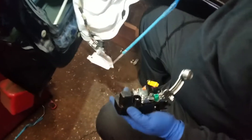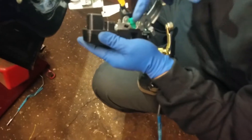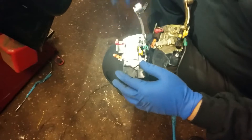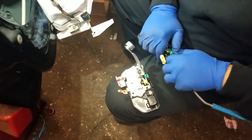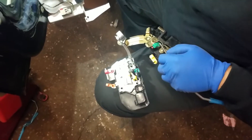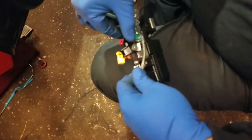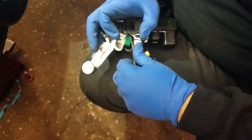We're going to start with the parts. As you can see, it has four little rods that are going to be connected to it and they are color-coded: green, yellow, orange, red. You have to make sure you remember which one goes where. In this case, the green one is going to be for the door handle — the one inside the car. Make sure you put that one in first. Slice it through and make sure the lock gets locked with the lock system.